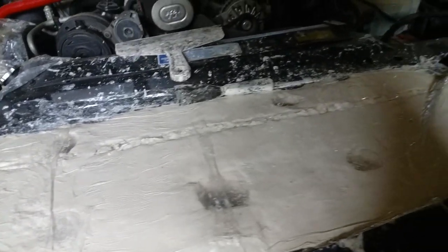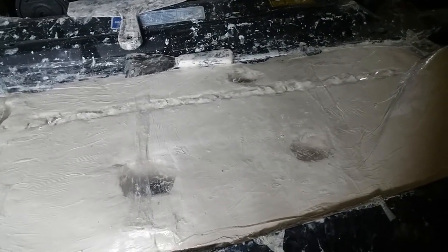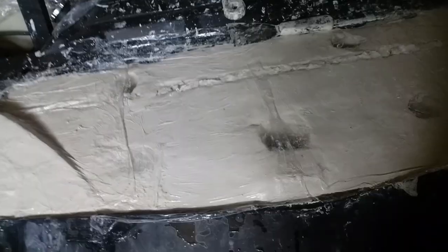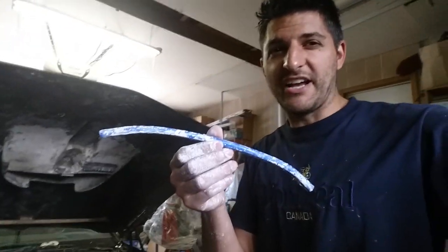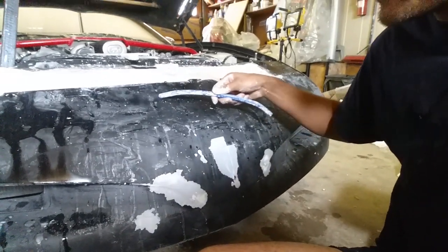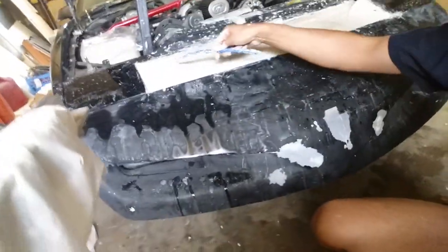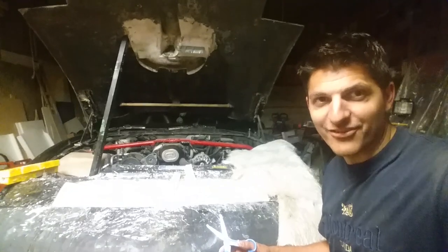It's three days later, I'm covered in clay, and we finally got ourselves a shape. I've got holes in there — think of reverse filling. I'm going to fill them with fiberglass and they'll become little legs that the panel will stand on. For shaping, I used a drawing snake — it's used in architectural design, it curves and takes shape. This part is for the cutout of the scanner, and this part carries on the line. It took about four packages of clay.